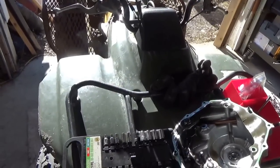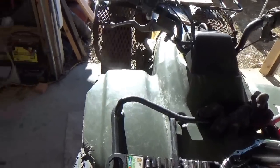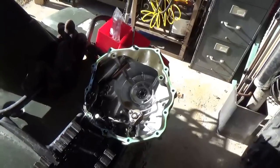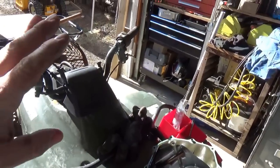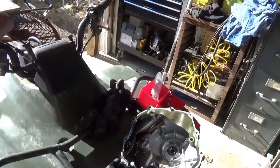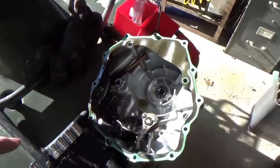You're using engine braking basically, and if you're not in exactly the right place the gears will clunk. These have synchromesh transmissions so they will shift, but if you keep doing that you are beating up on the gears and eventually you'll get some kind of failure. It's much better to have your automatic clutch working properly - as you step on the pedal it disengages the manual clutch, you shift, you let go and it re-engages the manual clutch and you go forward.